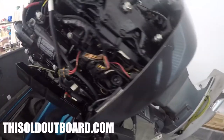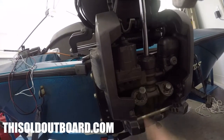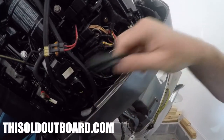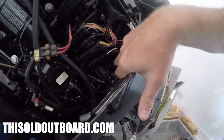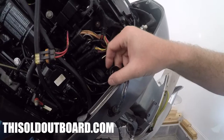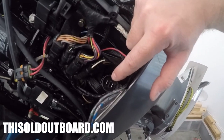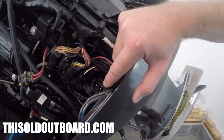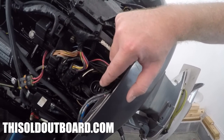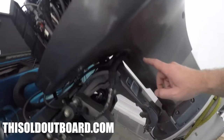If you do that and you hear them both clicking, the odds are pretty high that it is your tilt trim motor, and this is the motor that's probably going to need to be replaced. One more thing you can do: there is a plug here and this is the other end. It goes into here, and hidden back behind here is a little bracket with a tang that slides into this slot right here — that tang is what holds this connector tucked back in there. You should measure 12 volts across these two pins.